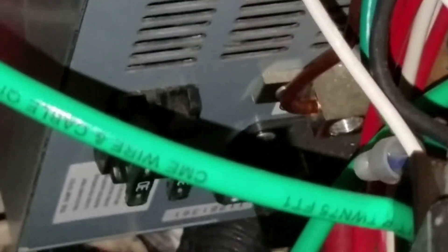Everything in here grounds to the truck camper or the truck engine battery negative terminal — that is the ground for the whole system. Down here on my controller, you can see the ground wire. Looking closely at it, the ground wire sticks into that ground block connection, and somehow the screw has backed out, so I need to get a replacement screw for that.